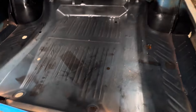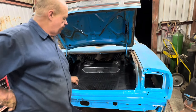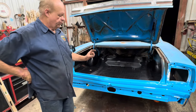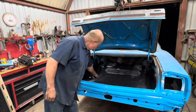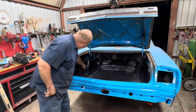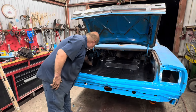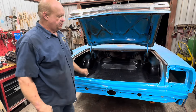You got to go back and put the seam sealer on it, and still got to do the work on the quarter panels and the gutters and stuff here. But up under it — solid as a rock. Now we've got to weld the frame rail on this side and put a small patch on this side. This frame rail was good and solid — all it had was just about four inches that was kind of rusted, not terribly bad. I went ahead and made it like it needed. Put the cross brace in there, welded the gas tank mounts to the bottom of the floor pan. I made inner and outer wheel well patches to fix all this because it was all rusted out down here. Got all this welded back together, all tied back in. It's super strong now.